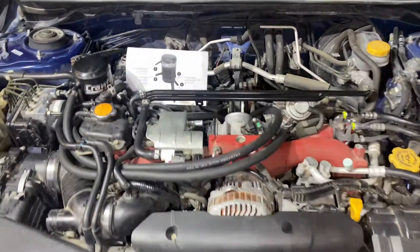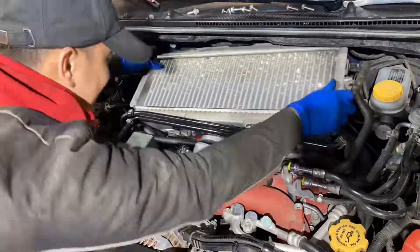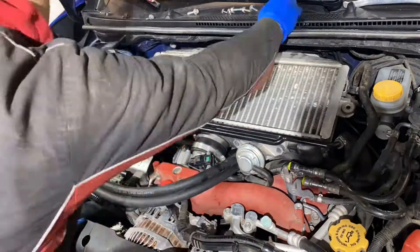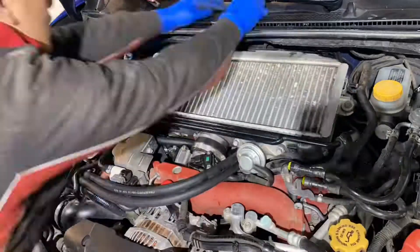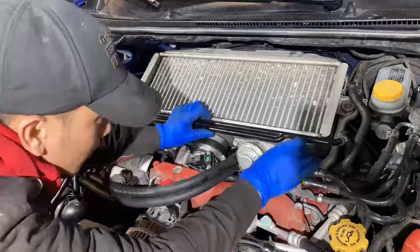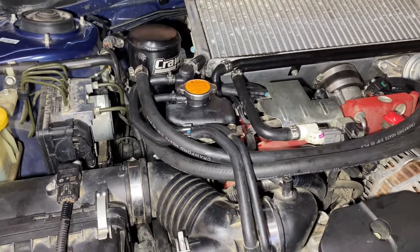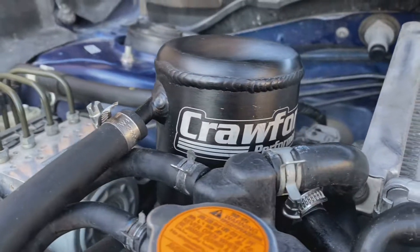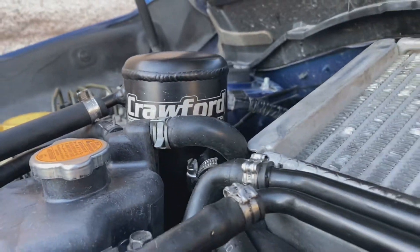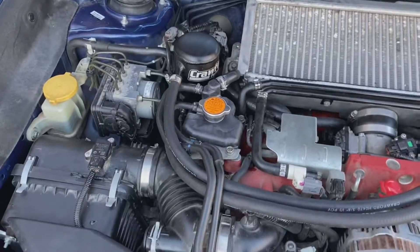So that's pretty much it — I just want to make sure those lines are installed properly. Now we can finally secure the intercooler. Be sure that none of the lines we just installed are kinked or pinched, because that's going to cause excessive crankcase pressure which will also cause oil seals to leak down the road. Make sure this plug is secured properly as well as the one by the firewall. Feel free to share this video with anyone looking to install this kit or something similar, and for more upcoming videos hit that like and subscribe button — see you guys, have a good one.